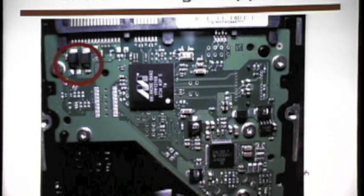All right, so how'd you fix the keyboard fuse? Yeah, you jumper it by sticking a penny in it or something like that, right? So the keyboards had a fuse that if they blew, rather than blow something on the motherboard, you actually would have to resolder it on the motherboard itself to prevent the motherboard from dying.